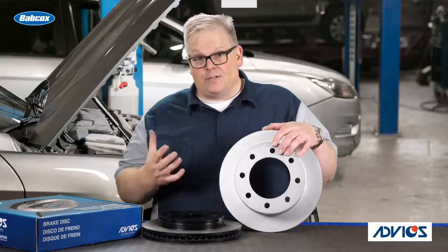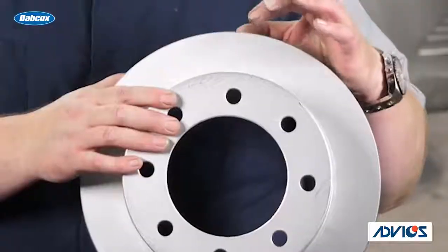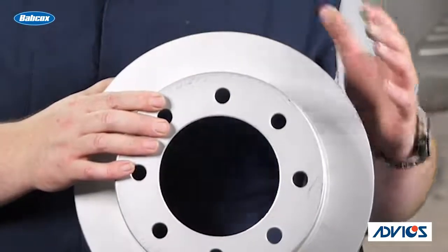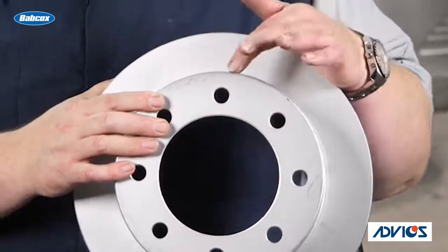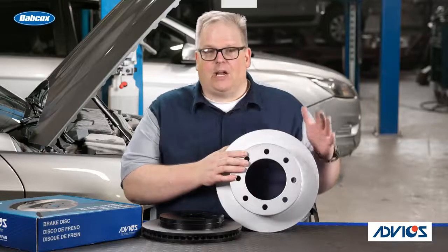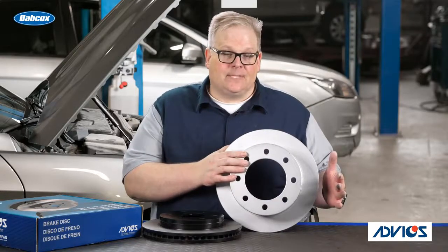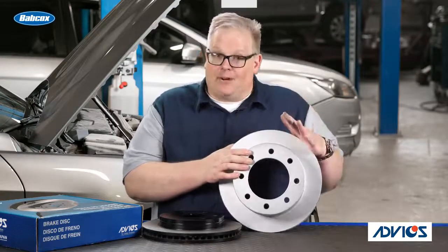Let's apply this to your inspection of brake rotors. Sometimes you will see cracks in the outer areas of a brake rotor. Some of these are fine as long as they're not too big, but once they start getting near this area or into the hat of the rotor, this is when a rotor becomes a safety issue and needs to be replaced. So make sure you're inspecting the rotor for cracks and also for thickness and runout.